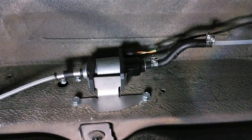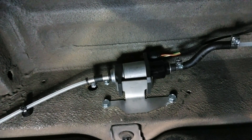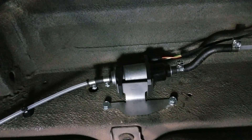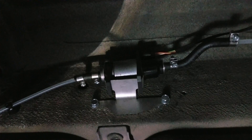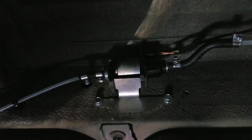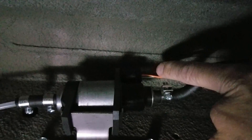Now we've come to the front of the vehicle — this is right next to the diesel tank. That's the little pump. The instructions made it sound like I could just tap into a rubber diesel line, put a T in it, and run it over, but it certainly wasn't that easy. I had the Mercedes dealer doing some work, they had the diesel tank down, so they went ahead and ran this line from the tank — I wasn't comfortable doing it myself since there are multiple lines in there and you don't want to tap the wrong one. They charged me about $80, which doesn't seem bad. The wiring harness comes from the controller and the diesel line runs all the way to the back.